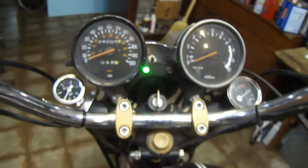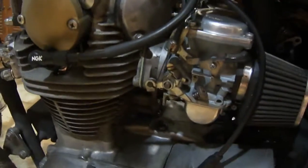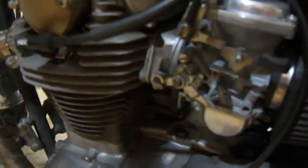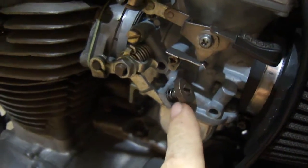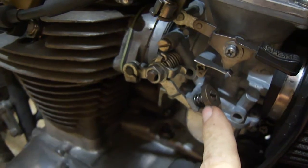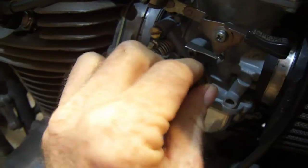So we're going to come down here to the carburetor. When I do a cold start, I put the choke on. The idle stop screw is a really big stop screw from an XT500, so I like to idle it way up when I do a cold start.